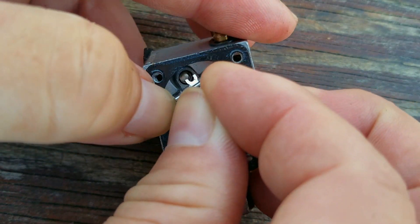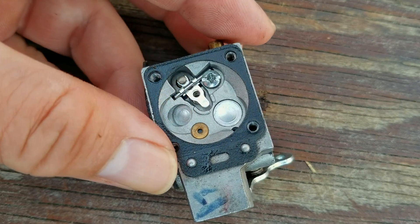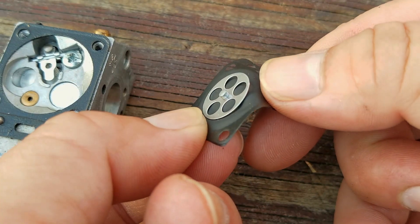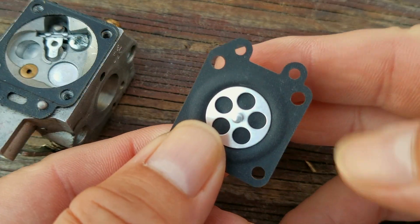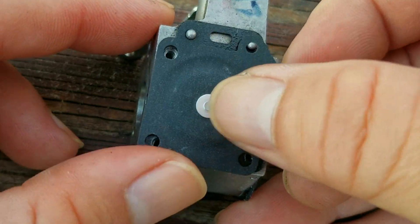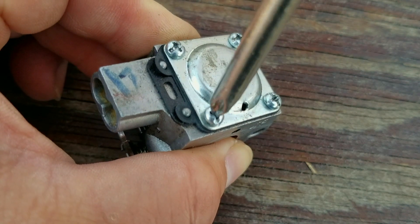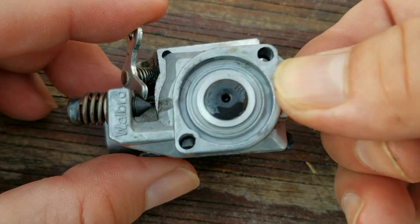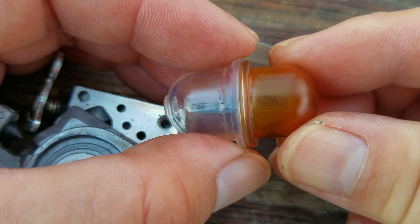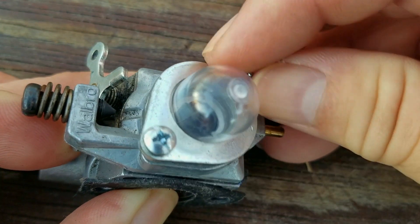Since our screen is clean, we'll put the needle and rocker arm assembly back onto the carburetor along with a new metering diaphragm. The original diaphragm has four holes at the corners and two locating holes at the top, and importantly the stem in the middle is the longer version — keep all these points in mind when looking for a replacement. I'll leave a link in the description for the one I'm using here. Another reason this engine might not start is that it's worn out to the point there's not enough compression — the most likely cause is a thin oil-gas mixture, so make sure you follow the instructions on your bottle of two-cycle oil. The primer bulb isn't cracked but I want to replace it anyway. Primer bulbs come in two different sizes; this is the larger one, very slightly different from the original but it should still work. I bought this in a bulk buy so it was very cheap, but if you buy a single it might be about $5.